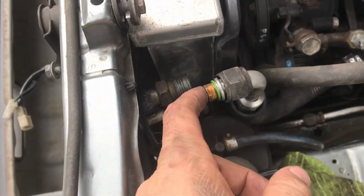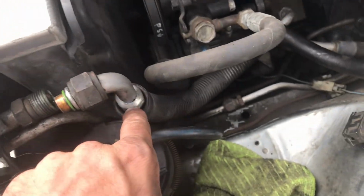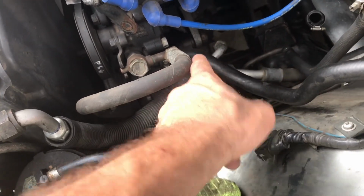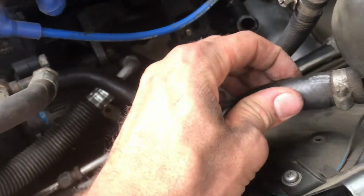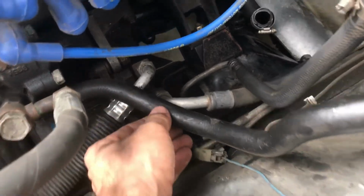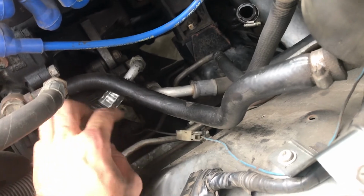So I took the O-ring out and put it onto this hose here, because this one has been remade. Got it made because this is a Series 3 hose on a Series 2 car, which makes it easier to run a turbo in there, because the Series 2 setup's this big thing here, so that's out of the way. I might even see if I can get a new power steering line that can go under here. As you can see, it's been kind of rubbing on the intake, but I'm going to remake the intake anyway, so yeah, I don't know. We'll see how we go.